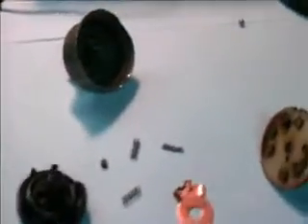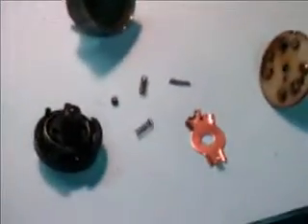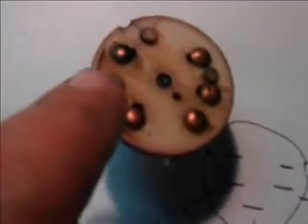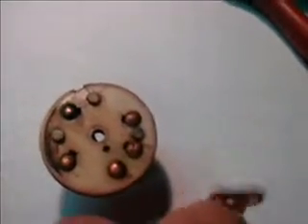Larry Elligan again. This will finish it up for your ignition switch. So we determined we had a bad ignition switch — so why not let's see how one of these things work. Here are all the connectors, and as you can see, they use copper rivets to make the connection on the inside of the switch. There is a plastic piece that has some springs and a ball bearing that makes the indent as you turn the switch, and then there is a copper contactor that fits on the bottom of the plastic piece that turns with the key, and it rides to make the different connections on these copper rivets.